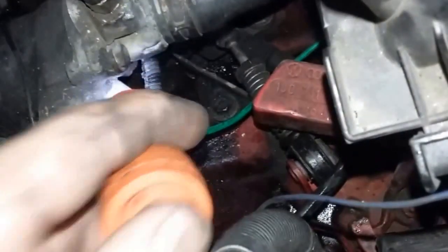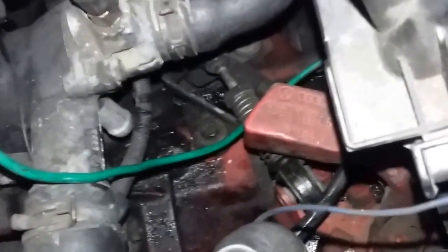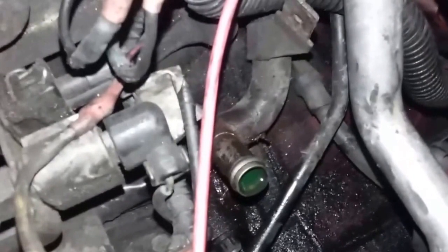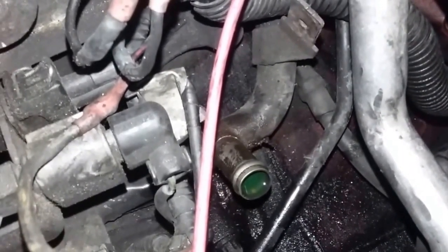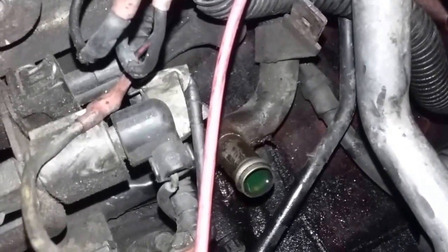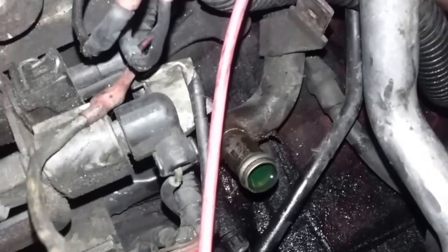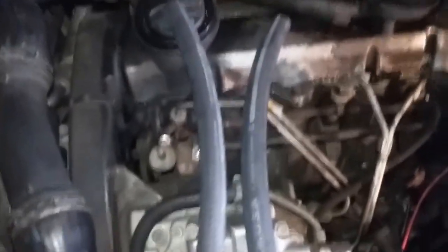This nipple and the other one I had to do all three steps. Don't use oil or grease to lube these when putting the hose back on because that can damage the rubber of the hose — use brand new straight coolant, the concentrated type, not the 50/50.